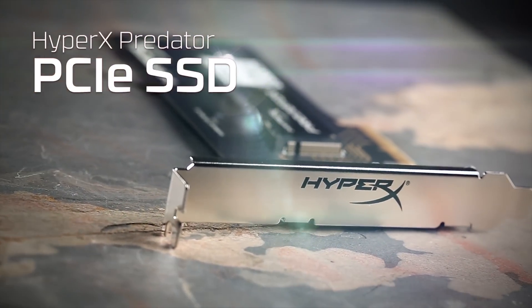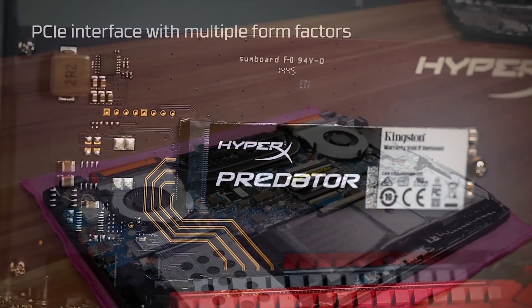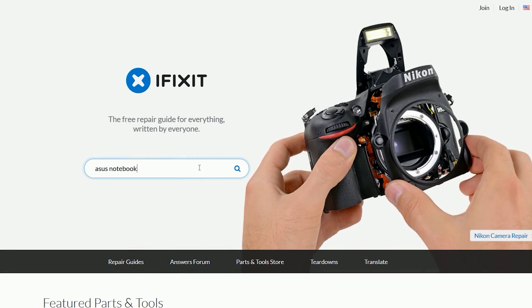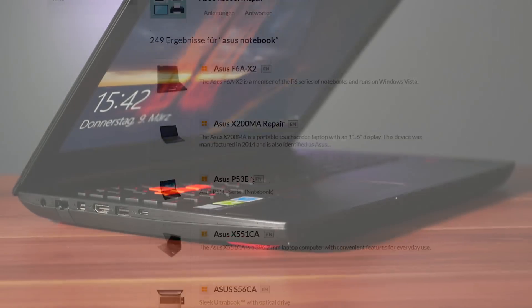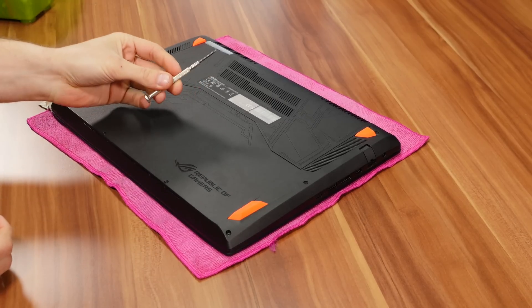If you're just looking for a cheap storage expansion, you can get the G2. For faster speeds and high performance, just get the more expensive HyperX series. Changing the SSD is usually very easy and just takes a couple of minutes. And if you don't know how to take your notebook apart, there are some guides on iFixit.com. Now before you open up your notebook, shut it down and remove the battery. Ground yourself or use an anti-static wristband and start removing the back cover.